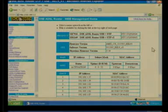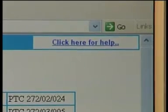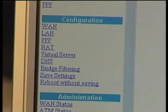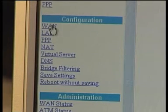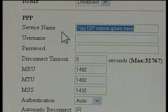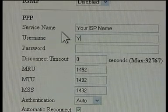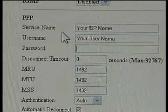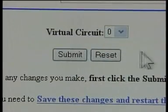The next thing you'll see is the router's home page. All of the router's settings can be accessed from the left panel, and more help is available at the top. While most of the settings are pre-configured for you, you'll need to tell the router the ADSL user ID and password supplied by your ISP so it can connect you up. To do this, look on the left-hand side of the screen under the configuration options and click the link to WAN configuration. You should now have the WAN configuration screen in front of you, and under PPP settings you'll see a space for your user ID and password — type them in here. Remember that user IDs and passwords are case sensitive and must be typed in exactly as your ISP advised. Once you've done this, click the Submit button at the bottom of the WAN configuration screen.